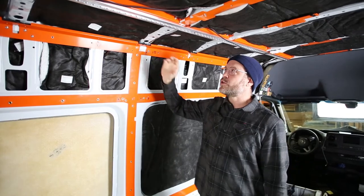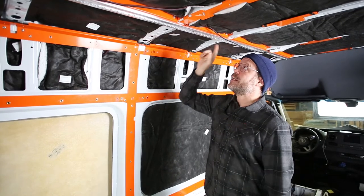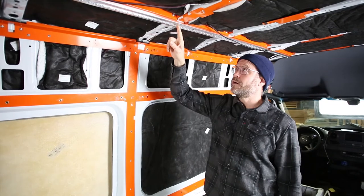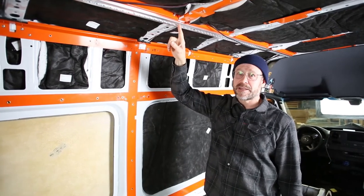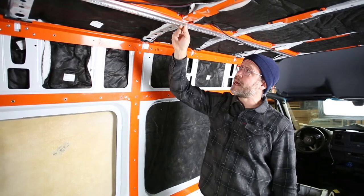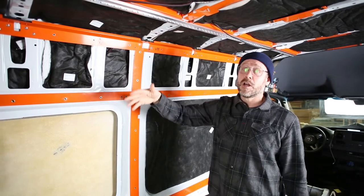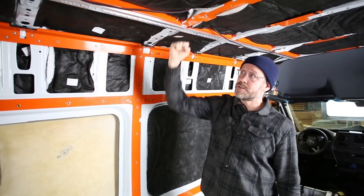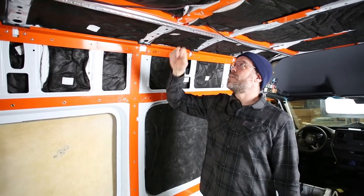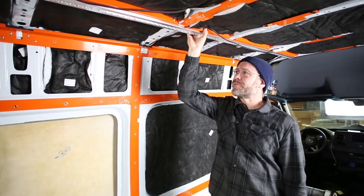First of all, if all you're doing is mounting L-track into these ribs with a riv nut, then certainly be careful on the weight that you put in there, maybe just your clothes and sleeping gear and stuff like that, but I wouldn't put a lot of weight into it. Over time, that will kind of dimple down, and if you have them overloaded, certainly in a rollover, they could just pull those riv nuts out. So that's why we do have the reinforced track, or speed strut here.